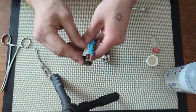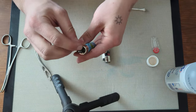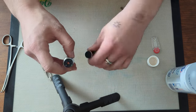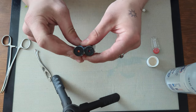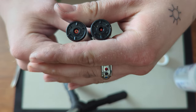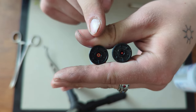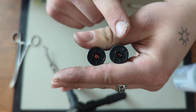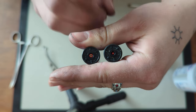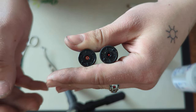To recap: the striker might be dirty, the flint might be out, the spring might be weak, or the nozzle might be dirty or loose. A little piece of advice — if you're buying Clippers, get the ones with the brass inserts. The one on this side does not have a brass insert; this one does. In my experience, the one without the brass insert will fail more commonly — the seal breaks, shoots out butane, and it's toast. The brass ones tend not to do that.